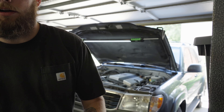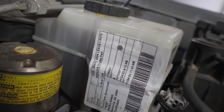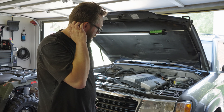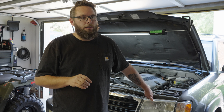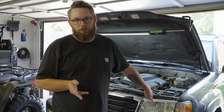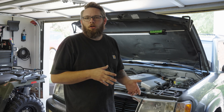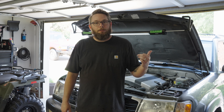We've got an update already. Basically it says we've got a master cylinder from a 2004, so this part has been replaced. Hopefully what that could mean is that it was replaced and the brakes weren't bled properly. I'm a little more confident that hopefully that expensive piece is good, and we will just need to freshen up these brakes and bleed them.